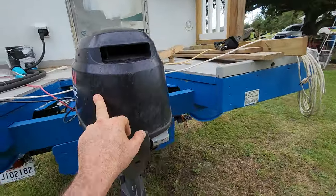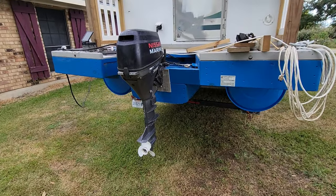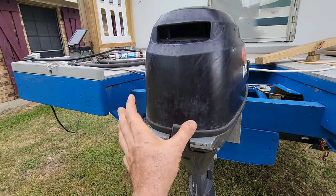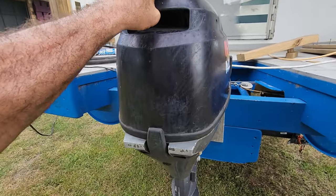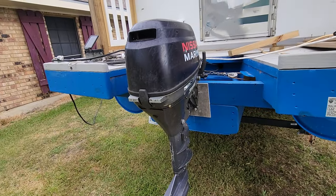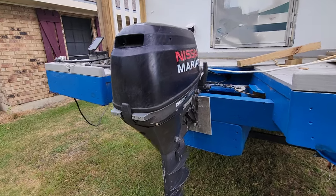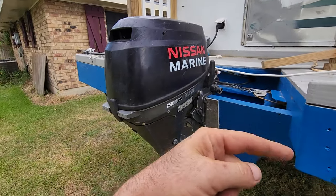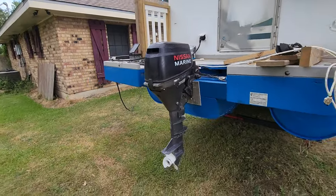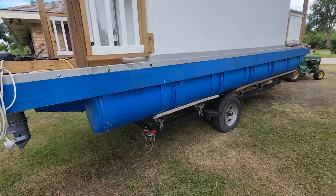I definitely have to change my fuel pump — it's bypassing and putting fuel into the base of my oil. I do have a new fuel pump to take care of that. The cover latch doesn't hold because the gaskets wore out on the cover, so if I forget the cover on while riding it bounces off down the highway. I've lost it twice. So either I buy another cover gasket, just remember to take the cover off for the highway ride and put it back on, or go ghetto and throw a bungee cord over it.